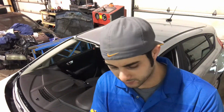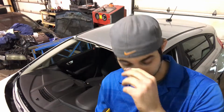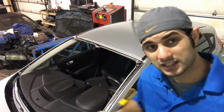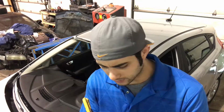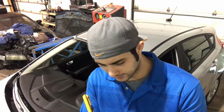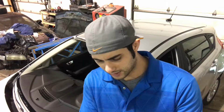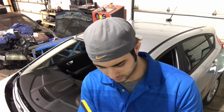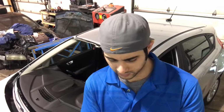The reason why we're actually modifying the tip for the urethane is because then the windshield will be placed on the perfect level every time, okay? Because on some cars, like let's say the Volkswagen, most Volkswagens, the plastic cowl clips in onto a molding that's on the windshield. So if you don't have it on the perfect level, you won't be able to put it back together properly. And there's a lot of other issues also with not having the perfect level.